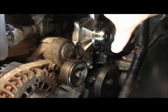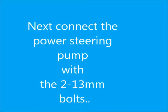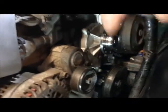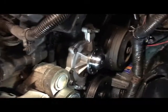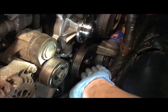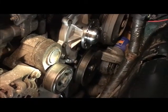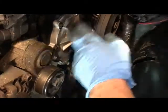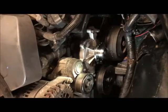Then I'll get the power steering bolts — there are two 13mm bolts to go back up. The pump is done. The power steering was the challenge: to get the two bolts through working with one hand is uncomfortable and you can't see what you're doing, you just have to do it by feel. This long bolt means the power steering pump really has to come out. The pump is up — I'll put the pulley on, then put on the belt and the job is done.